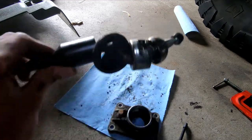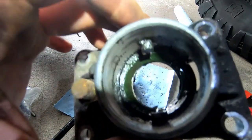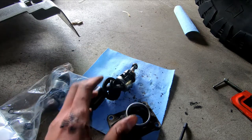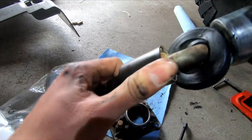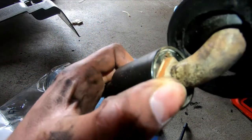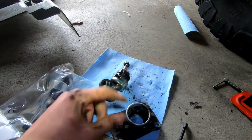I was able to take it out using the two-thumb method — it came out relatively easy. If you look inside it's all beat up and grimy. I'm going to clean that up, and before putting everything back together you want to make sure you grease the new one — you're supposed to use white lithium grease. Now I need to figure out how to remove the handle off the shifter itself. A lot of YouTubers use a wedge or screwdriver jammed in there and hit it with a hammer to unlock it.